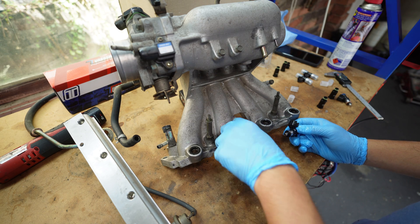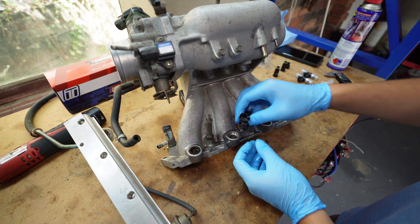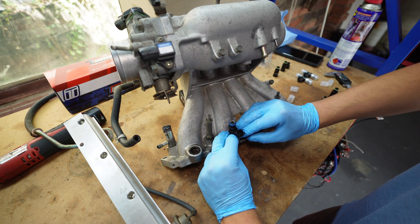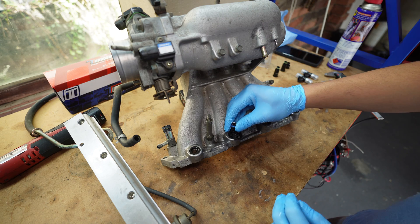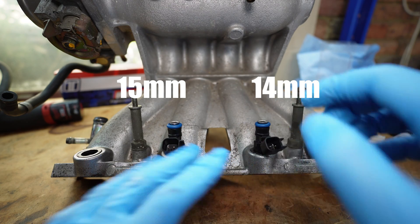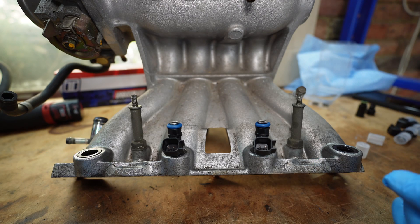Just going to fit it to this cylinder - pull out the square seal, pop it over the injector, and it'll sit perfect and snug in there. I'll show you what it looks like with the 14 millimeter - as you can see that's excessive movement. So we're going to install the rest of the injectors with the new o-rings and then put on the top hats.